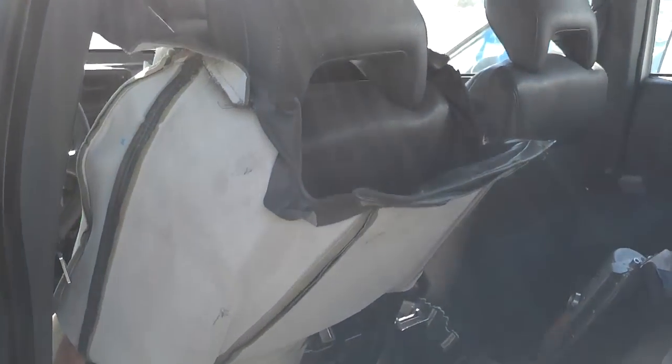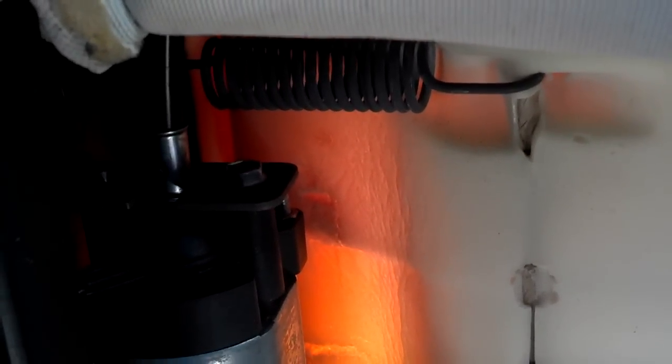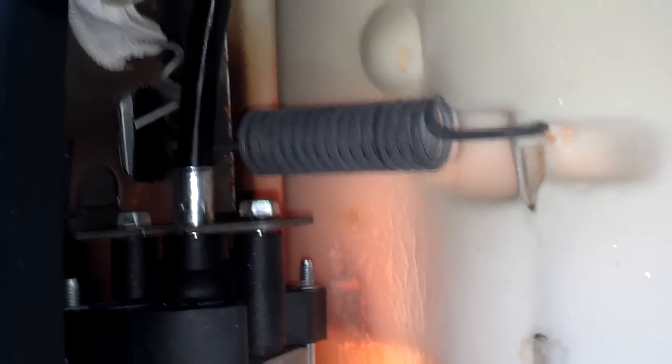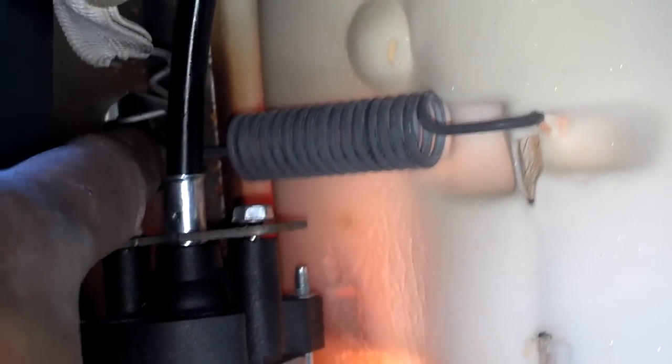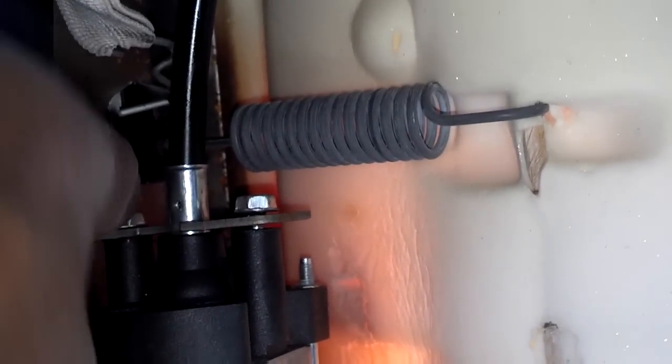This is the seat cover peeled up from the back side. Over here is the transmission. Right on top of the transmission there are a couple of bolts — they look like eight millimeters. I'm going to remove those two bolts because that will release the cable going through the top of it. If you want to get the seat back cushion out of your way a little bit, there's a hook right here — you can release that hook from its holder and pull the cover out a bit. You'll need a swivel or a little box wrench to get to this one, and they are 8mm.